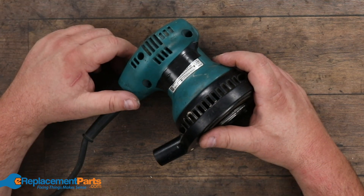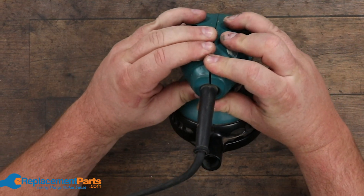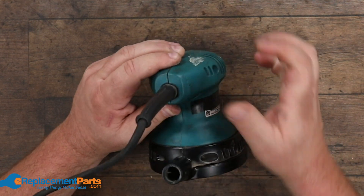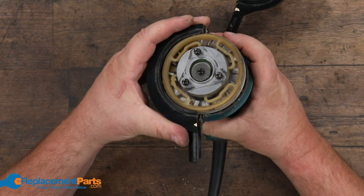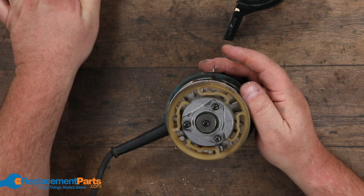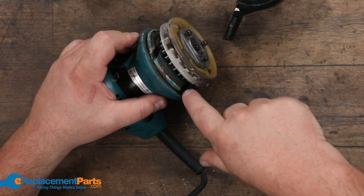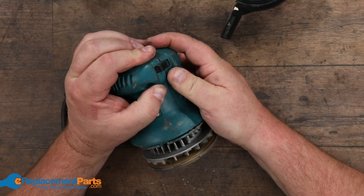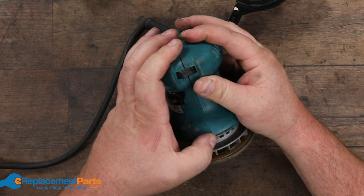Now that we've got the screws all out — and again they're all the same so we weren't too worried about using our magnetic tray — next thing to do is open it up. If you just try opening it, you'll see it is sticking. You can see we can open the crack up a little bit but not down the bottom, which means this black part somehow is holding it closed. So we have to look at that and open up the black first — and there she comes. We'll take off the bottom pieces first, always slowly in case there's any loose parts behind it, but there aren't on these particular sanders. Next we should be able to open up the blue, but if we look carefully we'll notice there's still two more screws hidden underneath. When you go to open these and start prying, I just try to use my hands as much as I can. You see that little crack starting? Follow the crack down to where it doesn't open — that's usually where something is hidden.